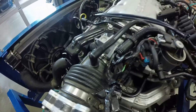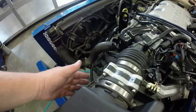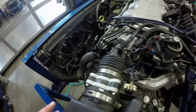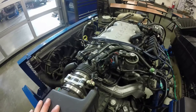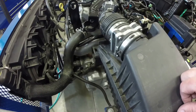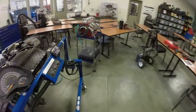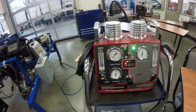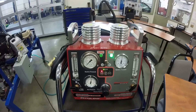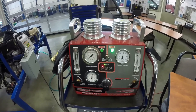With the leak fixed, we shouldn't see any other leaks. Eventually it'll fill up and come past the throttle plates and out where the air intake goes. You can see it starting to come through right now. That's really how easy it is to use a smoke machine to check for gasket leaks and other leaks. Earlier I showed a YouTube video on using propane to check for vacuum leaks — this is another method, and you don't have to worry about things catching on fire with this method.